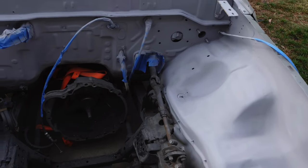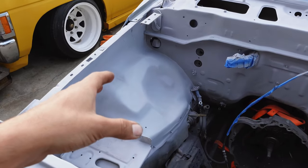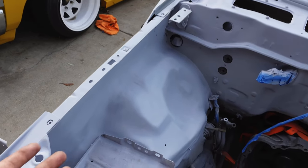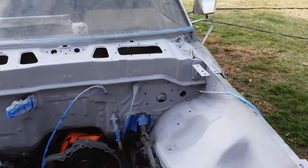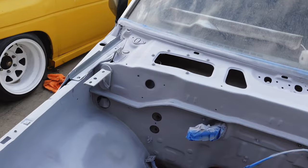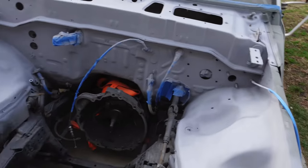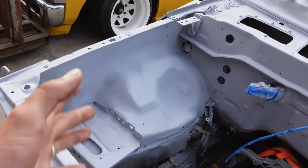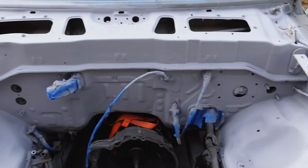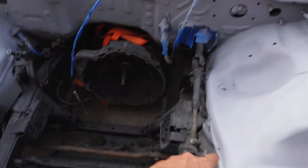So now everything is smooth and the engine bay is all nice and shaved. We just got some primer on here so we have a nice solid base for our paint to go on. I had to use self-etching primer in a couple spots where we had to grind down to bare metal, and I didn't want dark spots so I decided to just do the whole thing in gray primer. Real quick before I start, I'm going to sand down the primer — I think I'll use about 400 grit. Sand down all the primer, blow it off with compressed air, hit it with acetone, then start to mask off everything.